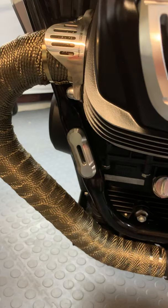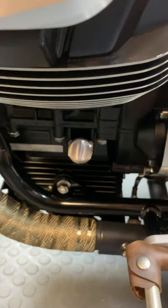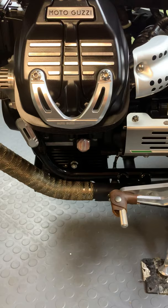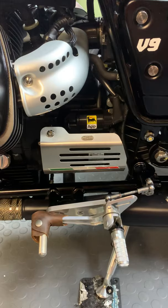These are the frame bolt covers. If you see an original Moto Guzzi without them it's just two ugly bolts. This is a dipstick from a T5, which of course didn't fit directly; I ended up using a stainless steel adapter and adjusting the length of the rod so it doesn't interfere with the engine and I get a correct oil reading. This is the cover for the starter — it's made by Bäck, it's stainless steel, laser cut, and absolutely gorgeous. The original is an ugly plastic piece and I absolutely hated it.